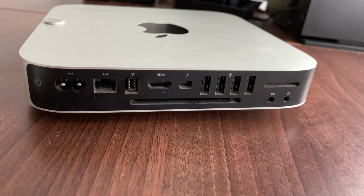So I will be upgrading the system RAM at some point — it's quite expensive to pick up at the minute. I'm looking for either 8 or 16GB of RAM to stick in it. But what I'm doing now is I'm going to dismantle it, give it a bit of a refurb, pop the SSD in, then reinstall macOS and get it updated to Catalina, which I think is the latest for a 2012 Mac. So I'm going to crack on with it now.